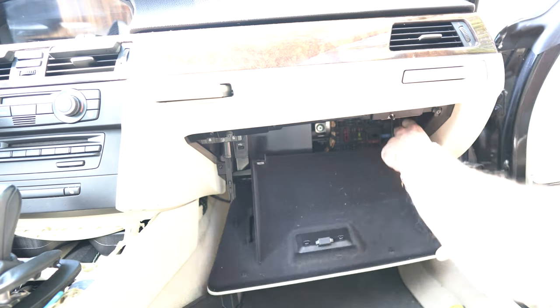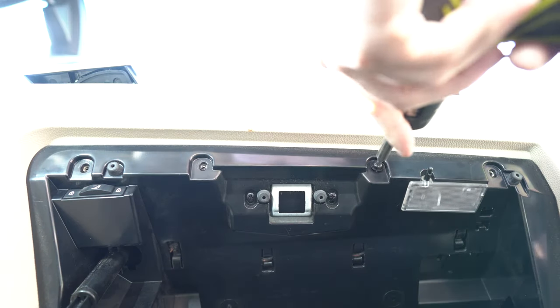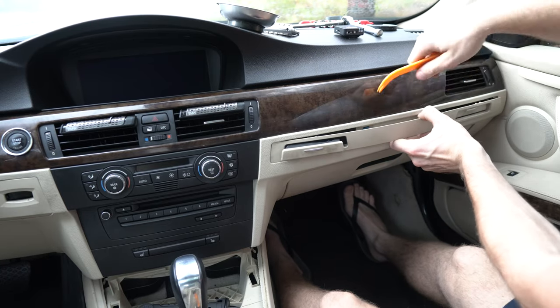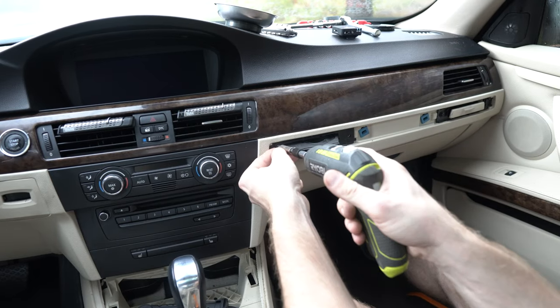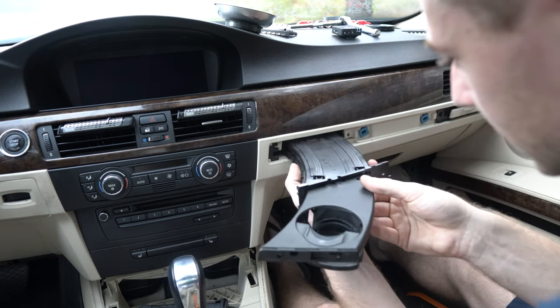Now press on the right wall and release the drawer. Undo six Phillips head screws around the body of the box. At this point we have to remove the cup holders — just pop the trim cover, use a plastic tool to get under from the right side and work your way toward the other side. Same story with the screws on the cup holder. I had to remove the trim due to the cup holder being stuck.